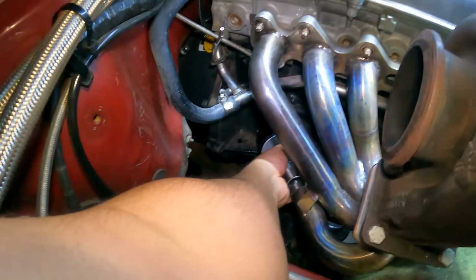So I need to shorten this little reducer. I got it all nice and flush inside there. Be nice and smooth, no slag. The way the 2-bolt was, honestly, it was kind of shitty. This is gonna turn out pretty smooth, literally smooth. So it took a little bit of grinding, but I got all that fitted up. Now I'm just gonna tack this onto the downpipe with the wastegate, but that should give me enough space. All right, so there it is, got the V-band all welded up.